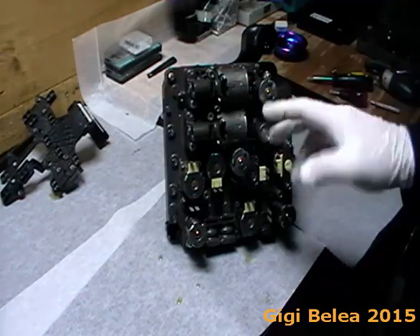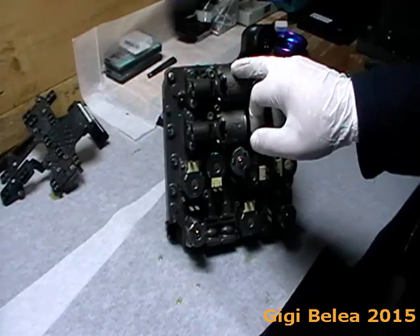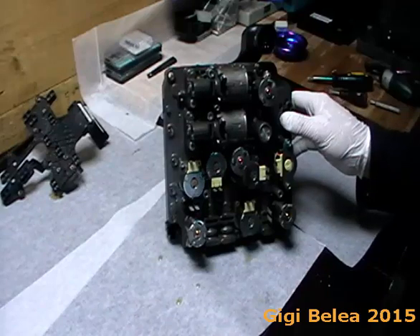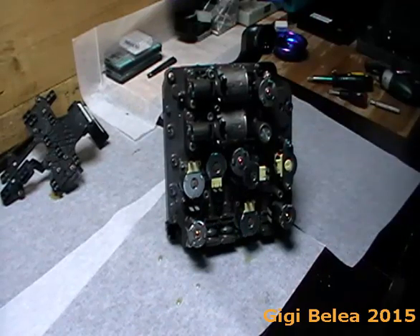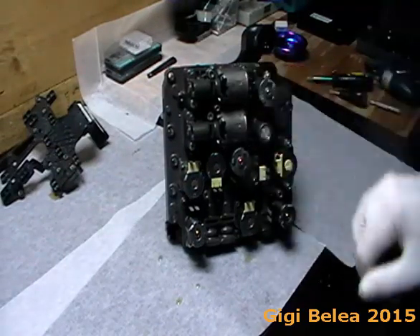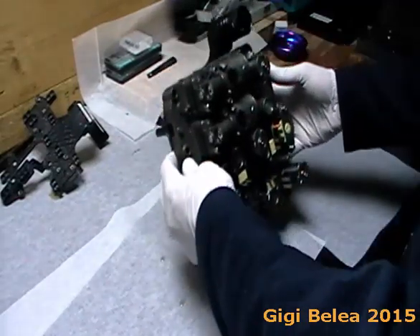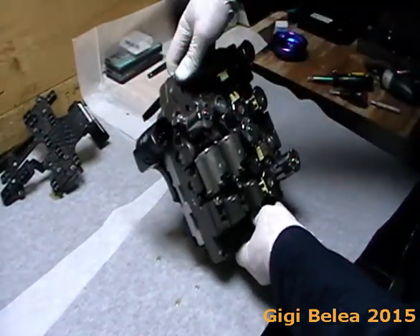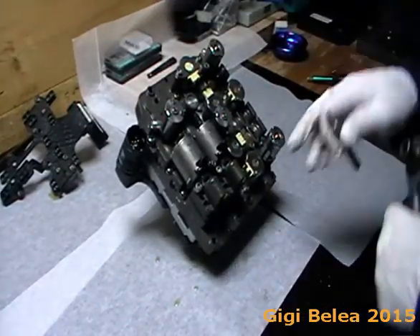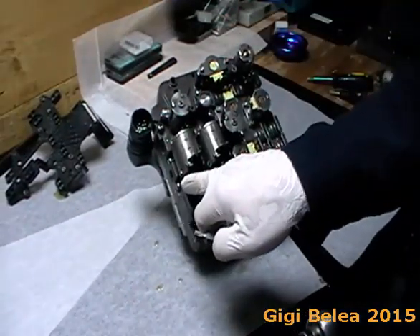Then we have N233 and all these small ones are the gear valves. Usually when something goes wrong it's the N215 or N216 valve that fails in these units. So what we want to do now is take out these two valves. They are held onto the valve body with four screws.